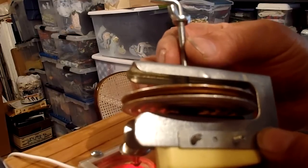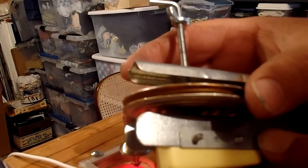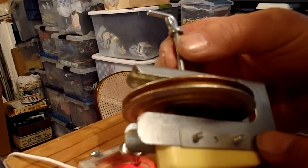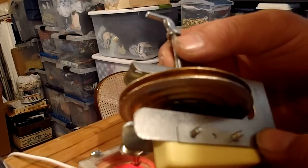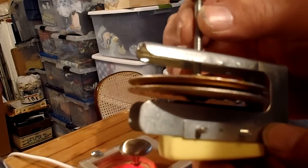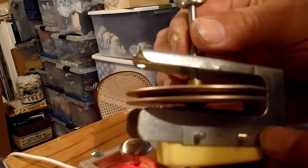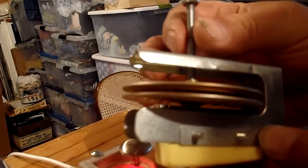There's a lot of movement in there. Any movement at all in the piece that this thermostat is sitting in would cause a big change in the temperature setting — you can see the big change in the gap between the contacts. So it's not very accurate at all in this condition.